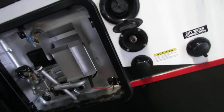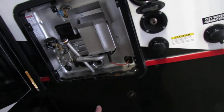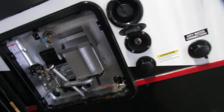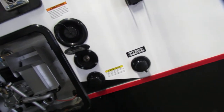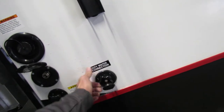You've got water up front. Black tank flush — you have to have the valve open to the black tank toilet before you hook a hose up to that; it's just going to flush the tank out for storage and smells. City water connection — from the park or from your house, put the hose on, screw it on, and just turn on the pressure.